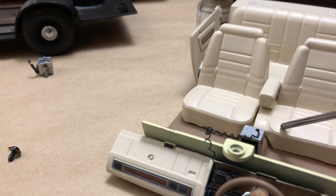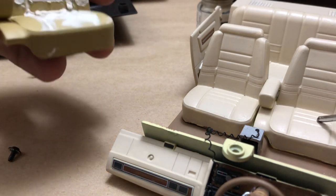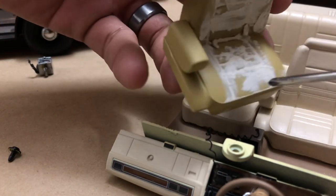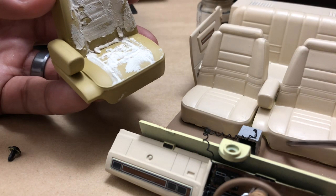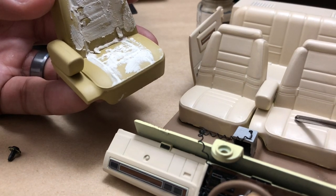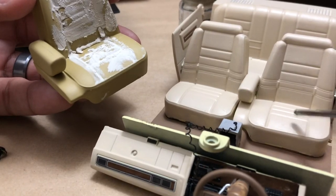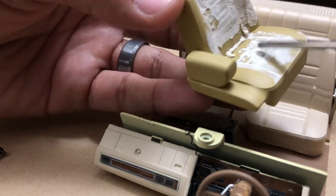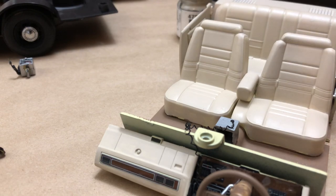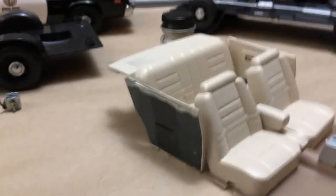On these fleet cars, the seat molding came lower and it did separate. They did have armrests. What I'm going to do is fill these seats with putty — these are rubber, so they're getting a putty treatment, then I'll sand them smooth so you don't see any of the pleats. This is going to be two-toned because they do the piping — slightly lighter color on this part, and the other part would have been more like a fabric versus vinyl. Same thing with the back seat — back seat really isn't supposed to have that kind of trim on it. So all that's going to get puttied up to look more like a fleet interior.